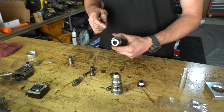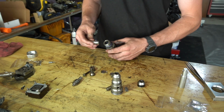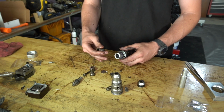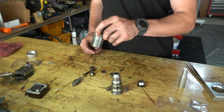And you'll want to just use motor oil in there. So again, oil side, so motor oil in there, or actually you could use diesel, either or. I used motor oil throughout the whole thing because I didn't have diesel. If you have diesel, you can use diesel on the fuel side and motor oil on the oil side. So once that's in there, lube this up, slide your plunger right back in. So we can set this aside right now.